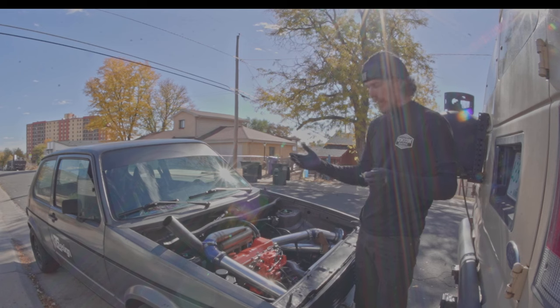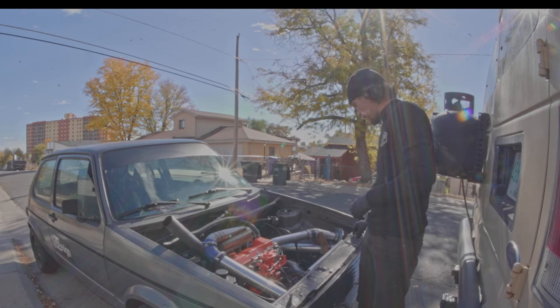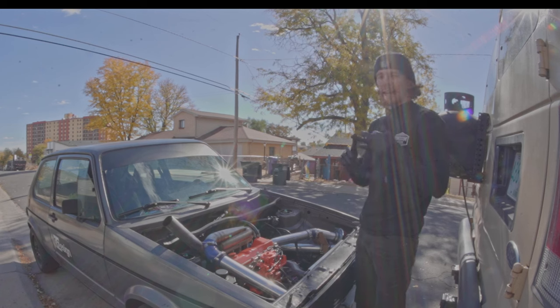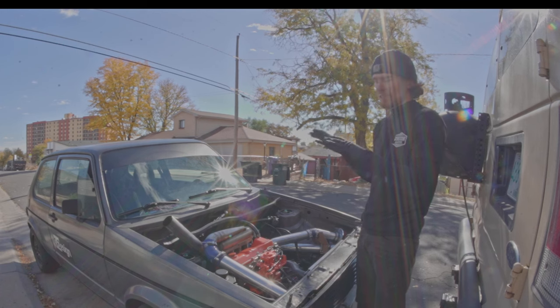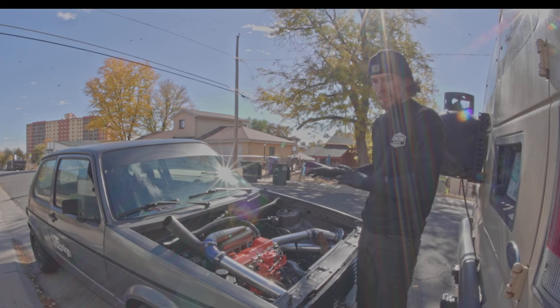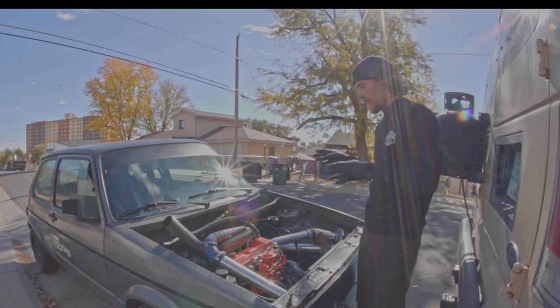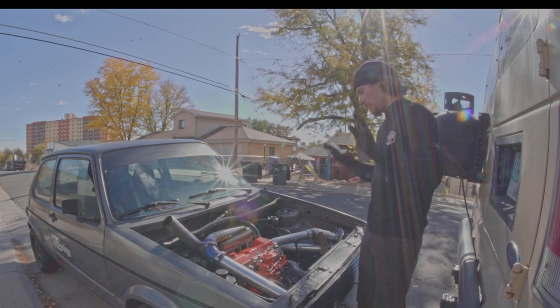On the other side of that, I'm going to increase the idle of my engine. In the wintertime for warmth and for overall cabin shake — the inside of these cars vibrates immensely with this diesel engine. The little diesel shakes like crazy, so dashboard rattles and steering wheel rattles, especially when it's extra cold out. Today I'm going to raise that idle to a smooth point for the interior, so the engine can stay warm, get warmed up faster, and just be smoother overall.